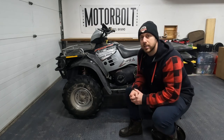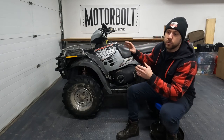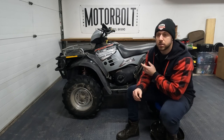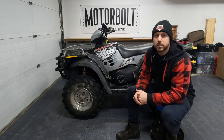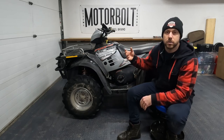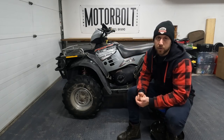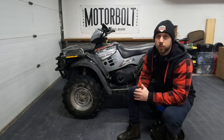At first we didn't think it was actually the head gasket - we thought it was just a water pump seal. On these quads, you have your water pump, then there's a water seal and an oil seal on each side. We thought those seals were bad and causing the oil to mix with the coolant, so we replaced those. We took a little ride and everything seemed okay, but after a while you could see in the coolant overflow tank it was getting brown with some oil, the coolant level was dropping, and the oil level was rising. That tells us there's either a head gasket problem or a crack in the block.